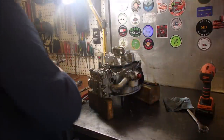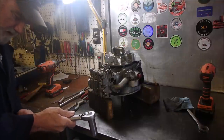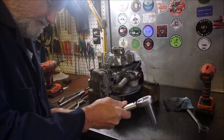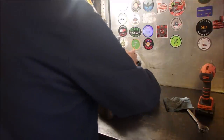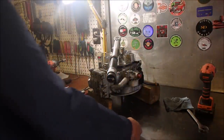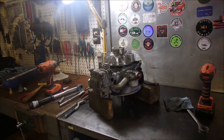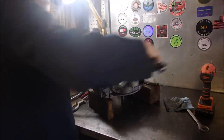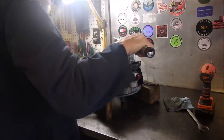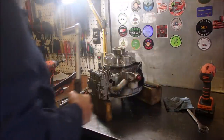Okay. So I want to put... I don't know if I can do that kind of heavy pressure on this one. Let's get up to 33. There's 35. We'll do it at 35. 35 foot-pounds. Right there, baby. I don't know if I've got the muscle to do this. It's when you do it on the lawnmower, you're holding the blade, right? Now, have I got a way to block that without breaking anything? Except my face? We just want to hear a click. Without breaking this nice aluminum. I'm not going to go any harder than that. I'm probably right there though.